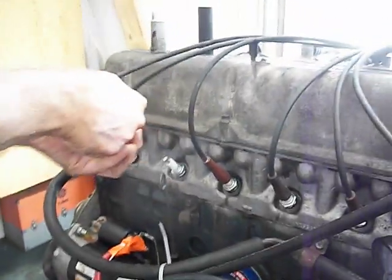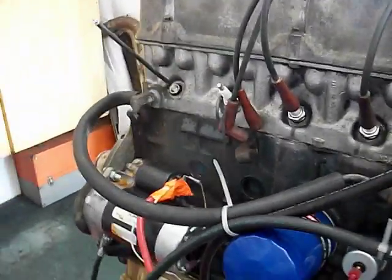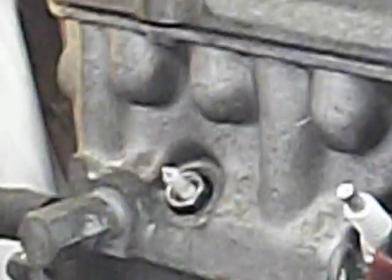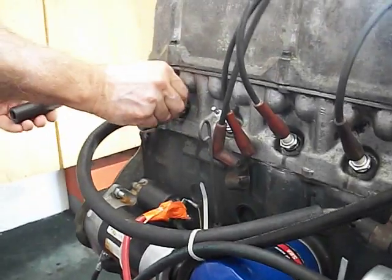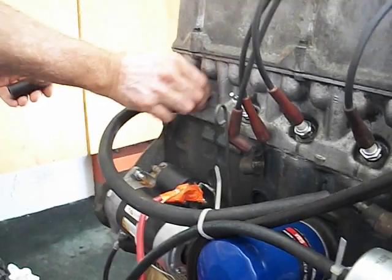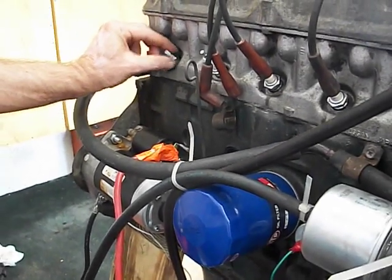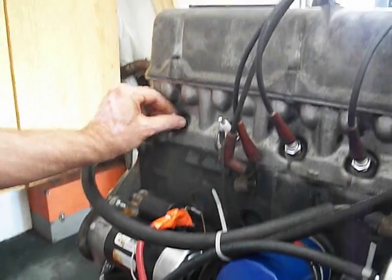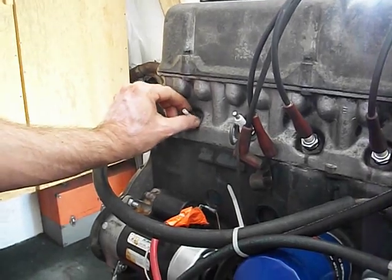What we're going to do now is swap that color tune plug with a standard plug, so you can see how the cylinder next to it is firing. We're just going to swap these around — take this color tune plug out, put it in number five, and you'll see the difference. I know that plug is clicking. I know that injector is clicking. The question is, is it allowing fuel to get through? I think it's maybe got a dirty filter on the tip of that fuel injector — that's what's keeping some of the fuel from flowing, creating an overly lean mixture.